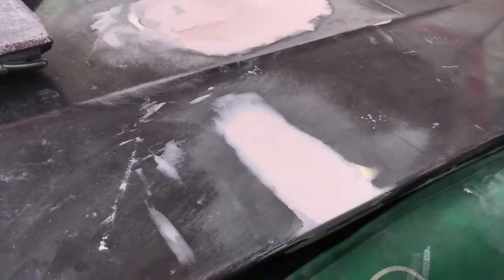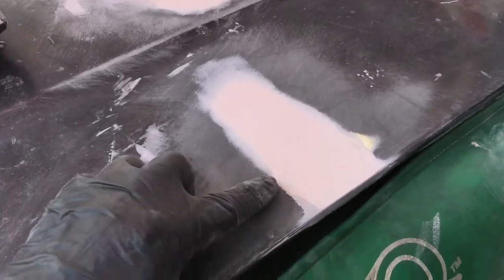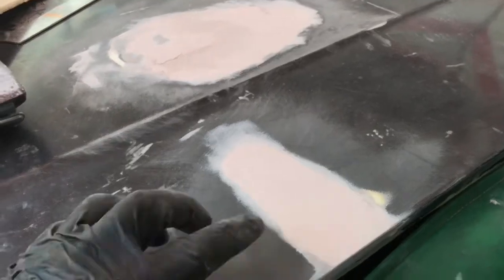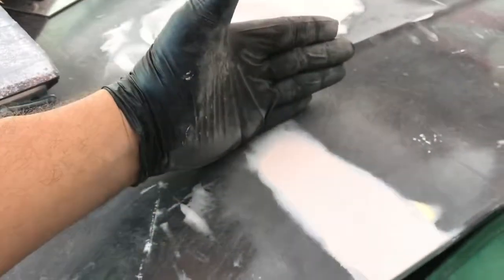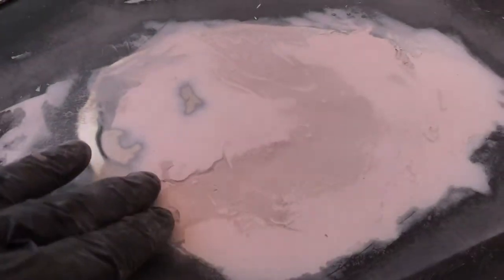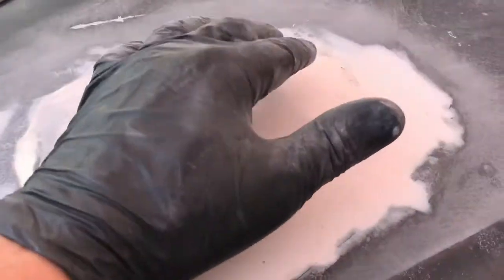All right, there's one coat, sanded with 120. Then I had to go 220, 240, whatever it takes. That is deep. I think that was from our initial prep grinding that I was trying to get rid of. Went through the spot putty there. It's pretty level. This mess over here, though, I'm going to have to fill in, that little area.